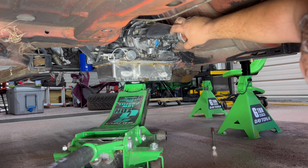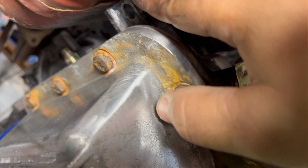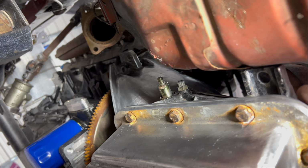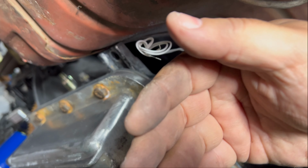Oh, in case you're wondering, part number for this frame brace is 10278587. Like, why would GM put a part number for this brace? I cannot go up anymore with the transmission because I'm hitting body here. So whatever this ear was for, shift linkage, whatever, I may have to cut that ear or clearance the tunnel some, because I cannot increase the angle of the transmission this way to get it to mount flush.